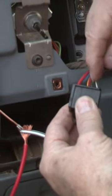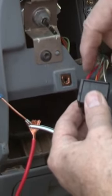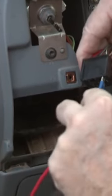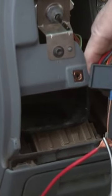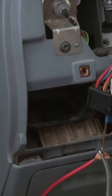We're going to bypass those and put voltage and current directly into the wires that are going to those tanks, one at a time. The first one is the rear tank — I've got a jumper wire that runs all the way back up here, and we'll push that on the battery and make the pump run directly to see what happens.